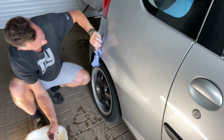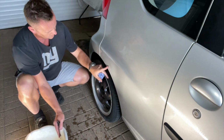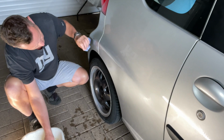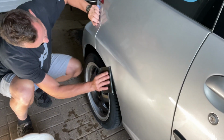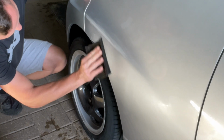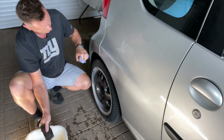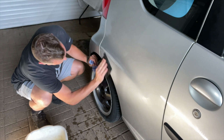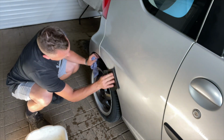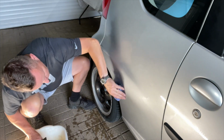And there's a bit of gentle faffing, you know, just slowly working it. Got me a run there as well, haven't I? Nice to bring that down a bit. Really gently on the old sand in there. Just keep it really wet. Lots of water on the wet and dry, and just slowly work it. I managed to get that run out, so that's good.